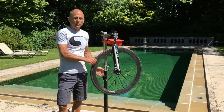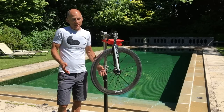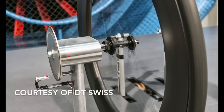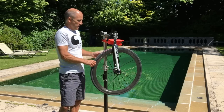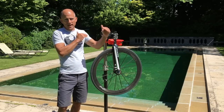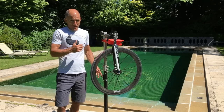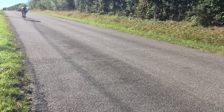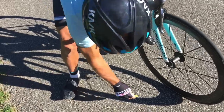The reason they haven't focused much on rotational drag is because it's quite difficult to do — it's expensive. You have to have a special rig with a motor spinning the wheel so you can measure the exact power it takes to spin it. In the basic experiment I did, you can see how the Lightweight was spinning down from 40 to 20 km/h much slower than the Karima, and that has been borne out in real-world testing where the Karima also shows slightly worse aero performance.